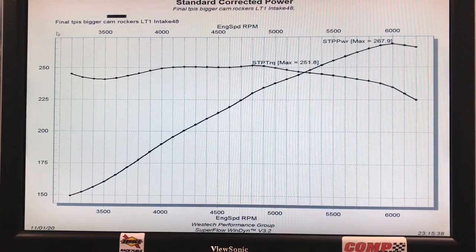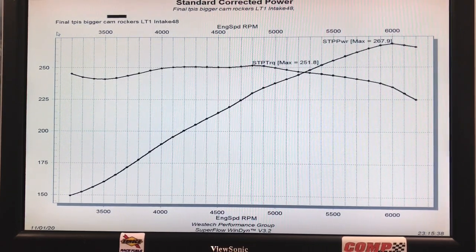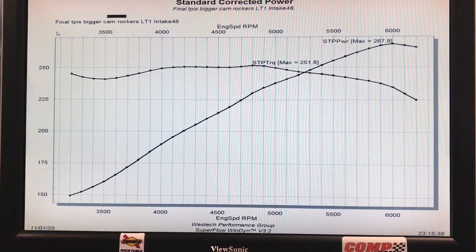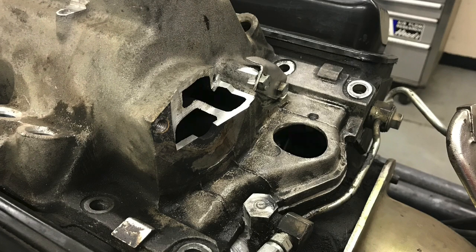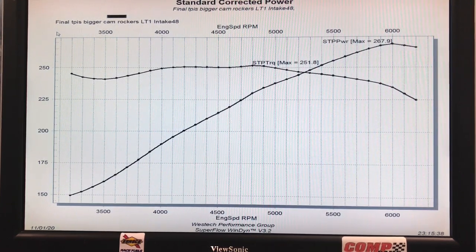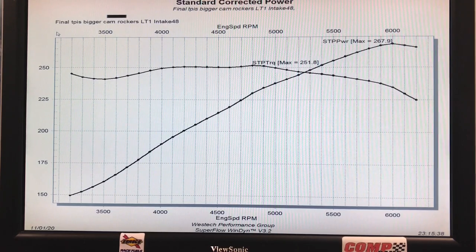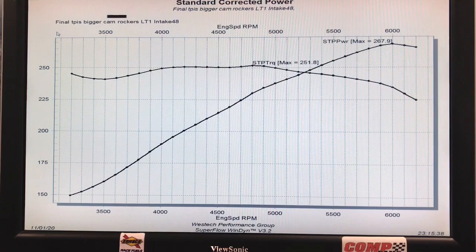This isn't a very big camshaft, but I would like to see if more valve spring would let it keep revving. I need to talk to Jim at TPS to see how high they're running these motors with those springs. But I was happy the distributor modification worked, even with the giant-sized hole in the back. All I did was wrap a rag around the base of it, and even though my distributor hold-down was at a different angle, it seemed to hold well. The distributor actually leaked less oil than the front of the motor — that was fairly clean — but the front, having taken the timing cover off multiple times for cam swaps, is leaking pretty good now.